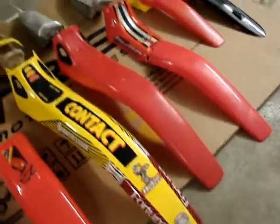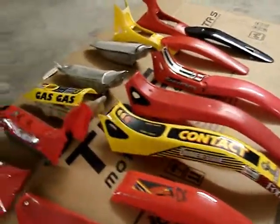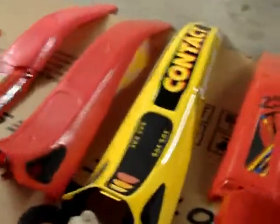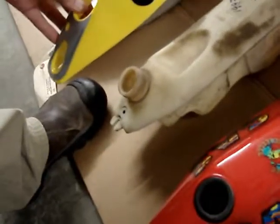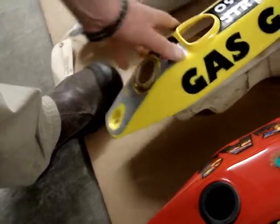96, 97 is the longest rear mudguard fender. It doesn't fit any other years because of the way in the front it ties in to the tank cover like that. The tank cover, again, is sitting on a fuel tank that may be black plastic or maybe white translucent nylon. That's 96, 97.